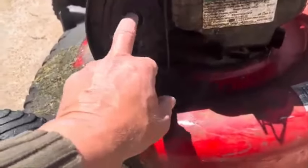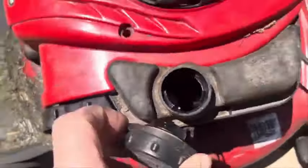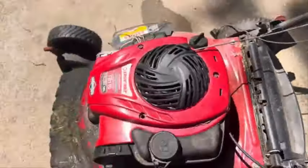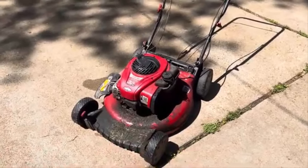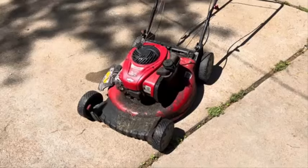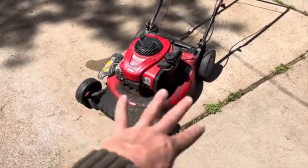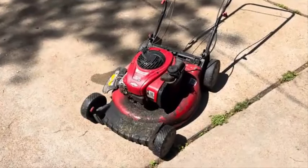You can see it's probably just full of oil in there, but once we work it out of the system — it's got gas and it doesn't look contaminated, looks like fresh gas actually. It smells a bit funky but mostly like gas. If it has a hard time running, I'll drain the gas too. First thing first: drain the oil down to the right level, give it a couple pulls to see if it'll pop, then wipe the deck down.